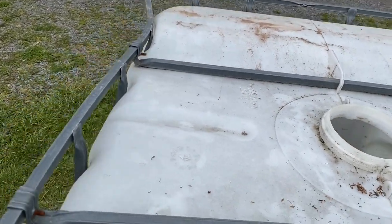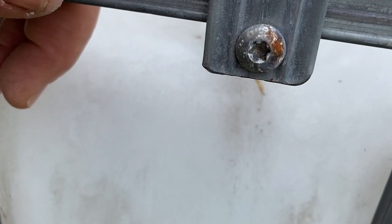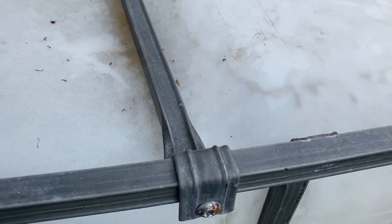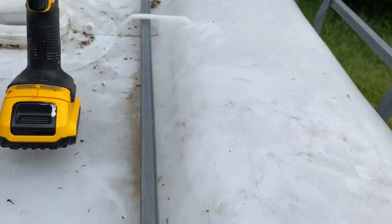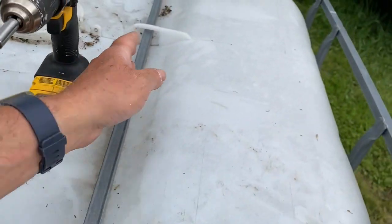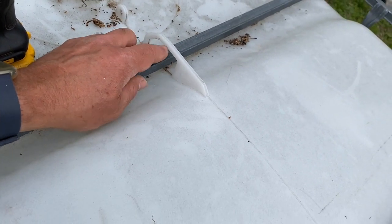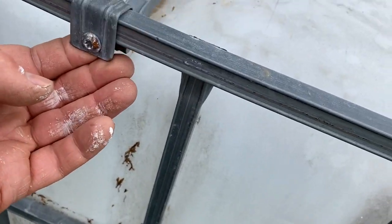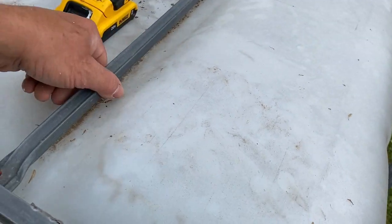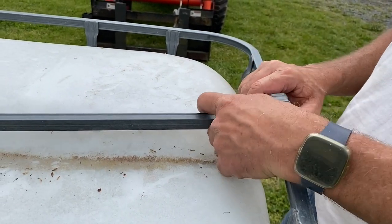Let me explain the process of what we're going to do. These two straps up on the top need to come out and they are held on with star bits. That is what the star screw looks like, and this is what the actual bit itself looks like. We need to remove both sides — it is held in by this little plastic piece right here. At which point we need to maneuver this around, turn it sideways. We have to lift it up over top of this once we get the screws out, then turn it sideways and pull it out. Yeah, that pops off nice and easy.